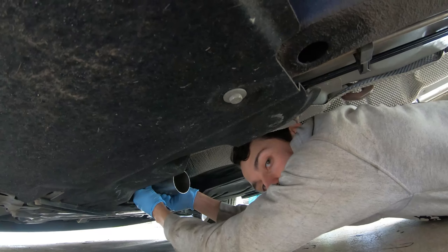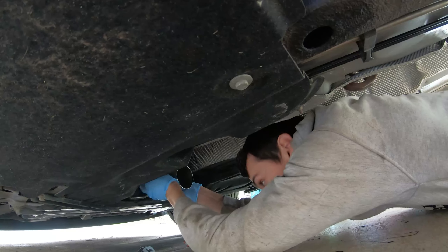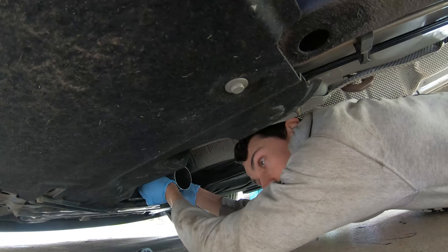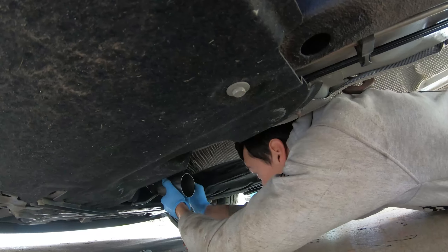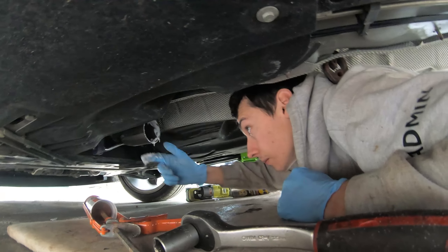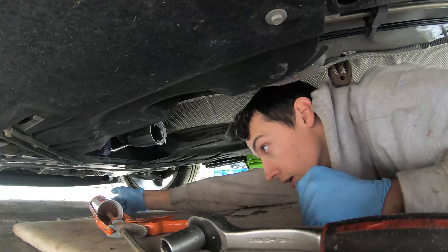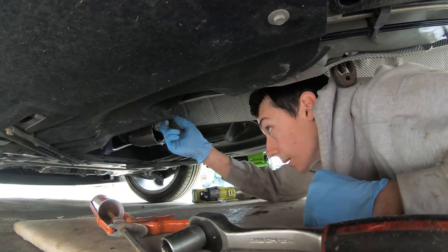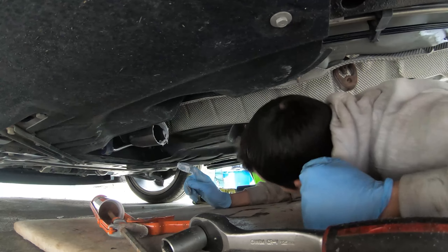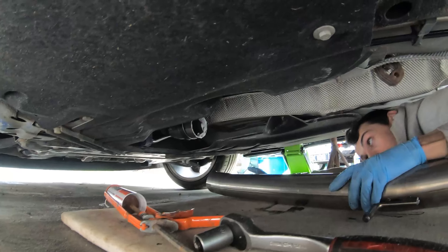We're just putting some assembly paste on. If you can, always do it from the front of the engine going backwards, and assemble as you go. Don't make them too tight because you can tie it all up at the end — it's nice to have a little bit of movement. Just getting some assembly paste — plopping a bunch of assembly paste in, making sure we're getting them nice and coated.